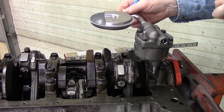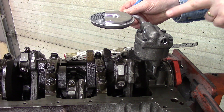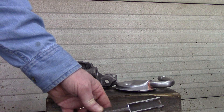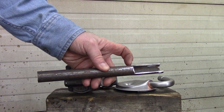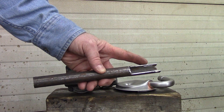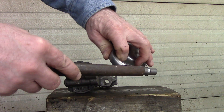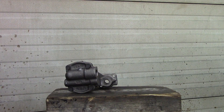I'll take the pump and the pickup off, install the pickup on the pump, and then reinstall it. Once you have your pickup and pump marked for where the pickup has to go, you need to install the pickup into the pump. There is a tool you can buy for this, but as everybody knows I like to make everything. This is a piece of half-inch pipe — I cut it to two and a half inches in length, then took a piece of three-quarter inch round stock and pounded it in to open it up so it fits better around the pickup. And that's how we're going to do that.